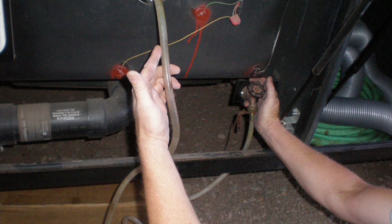You've got to remember you've got heavy water and waste inside a holding tank — you're sloshing it around and bouncing down the highway. These tanks are soft and pliable, even though it's likely high-density polyethylene, and it's still going to bounce around and create stresses that could cause that fracture to open again. It concerns me that the leak happens when it's only half full, because there's not that many things attached to the sides of holding tanks. In this photo, you can see the sidewall of a holding tank with an attachment for a freshwater backfilling device and some monitor probes so you can monitor the level of contents in the tank — connected to your monitor panel inside the coach.